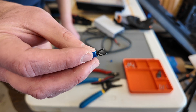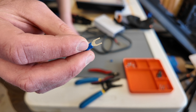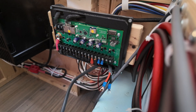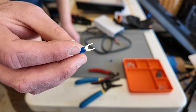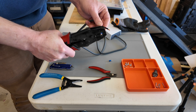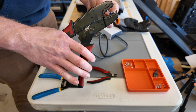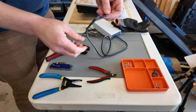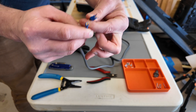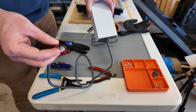I double checked and these are the connectors I'm going to need to use — this little fork kind of connector. It just works with my bus bar on my relay switch, which I'll show you in a little bit. So I'm going to get these crimped on the ends of these wires. I'll just crimp these on there. So, wired up — got the other end connected to the DC to DC power supply. Let's go install it in the rig.